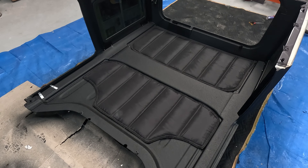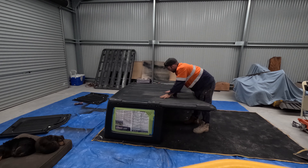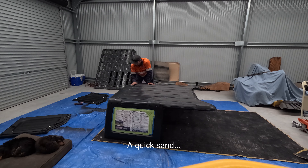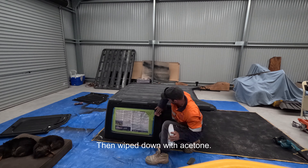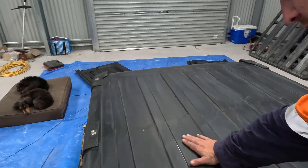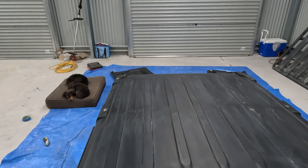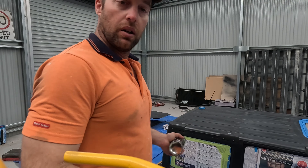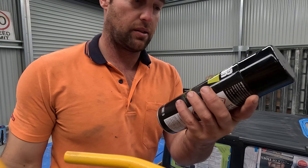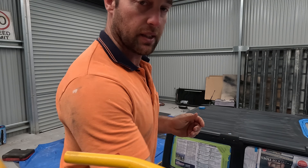Insulation done. Now time to turn it over and Raptor coat the outside. The idea with the sandpaper was just to rough it up a little bit, then I cleaned it down with acetone to get all the dust off. That's ready to go. I'm just going to finish taping up all the rubbers, and then she's all taped up. Once again, the adhesion promoter — just because it's plastic and it'll help it stick. Spray this on and let it set and then we're ready to go.